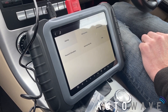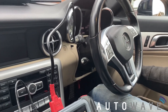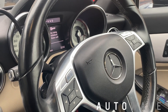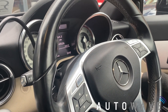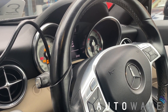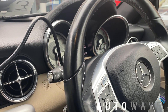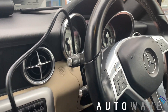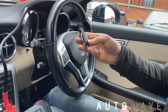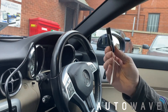Operation complete. If we now put our new key into the ignition, we have to wait for the key to be initialized — it'll just take a few seconds normally. That's been initialized, so now we should be able to turn the ignition on. Wait one moment, and then start the vehicle. Remove the key and just check the locking features. Central locking locks, central locking unlocks.